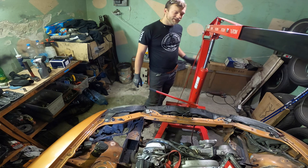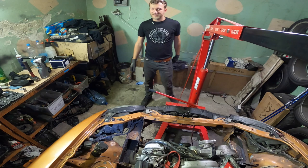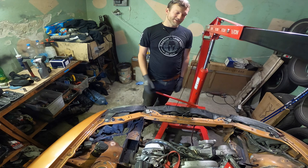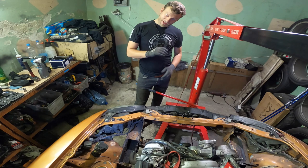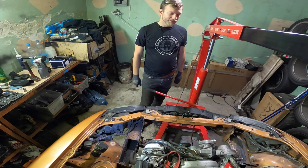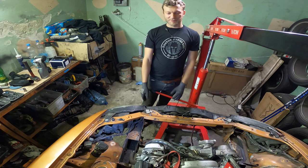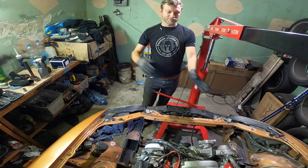I haven't found any, and it's a cast iron block anyway, which is certainly not suitable for Miata. So aluminium engine, you know, LS, there is nothing like this. So there is only really this one, or there is the BMW V8, which is super unreliable. It has the issue on the cylinder walls, they get stripped by the rings, and you have to rebuild them all the fucking time, and yeah, and they are actually bigger. They won't fit. This engine is for some reason small even though it's big. It's 4.3, it's the same size as the BMW, and maybe it's because of the bore stroke ratio. Who knows?